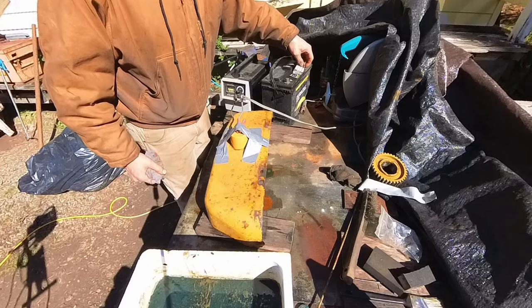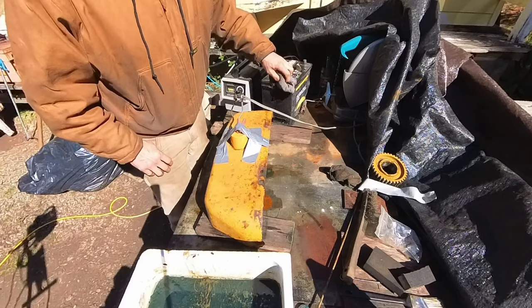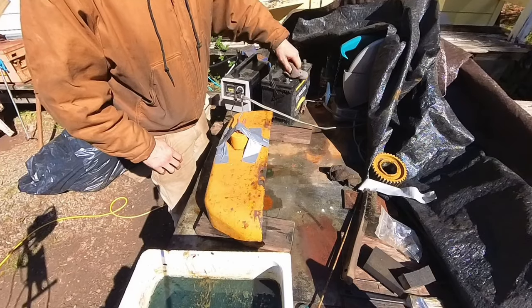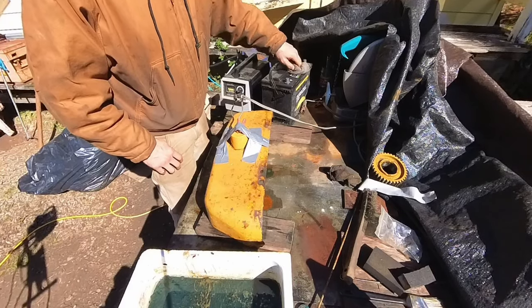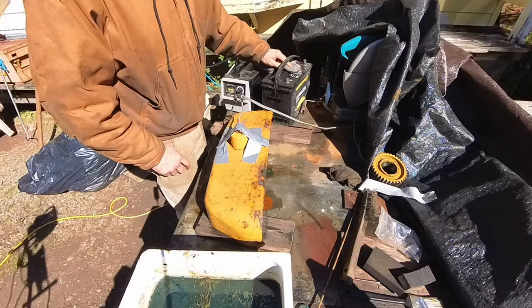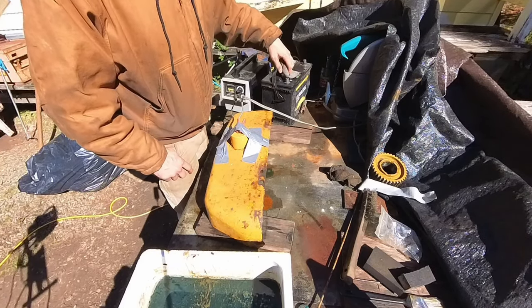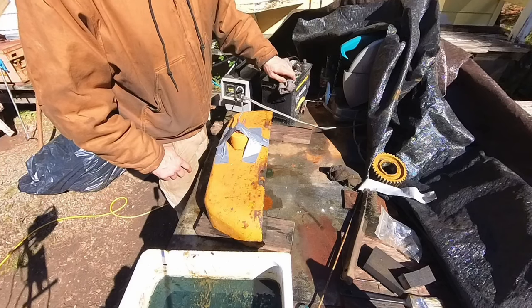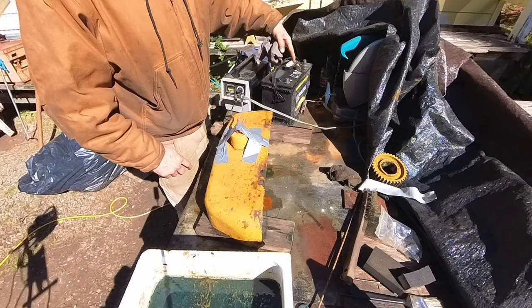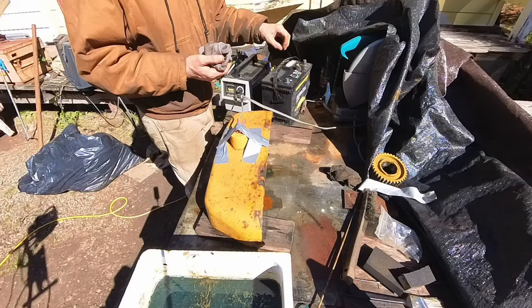This is an old recycled battery I got from a friend that was about 5-6 years old, and I refurbished it with a welder using the 50 amp pulses, and I just topped it back off with distilled water, and it brought like 300 or 400 cranking amps. So this battery is really old, but it has a little over 1,000 cranking amps. So I got it for free.